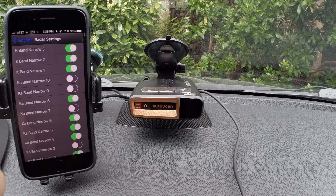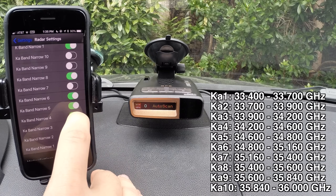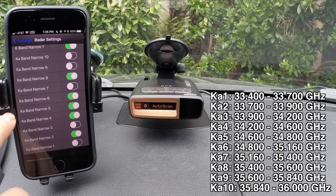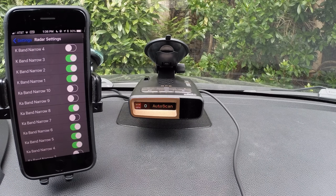The same applies to KA band. If you want to access KA band segmentation options, go up here and disable KA band — then you'll have all the segmentation options available. Here in the US, the main frequency ranges in use are segment two, segment five, and segment eight. Some people also scan segment four and segment six for out-of-tune guns transmitting around 34.7 GHz. Note that band segmentation adjusts only what frequencies the detector alerts to, not what it scans — it's always scanning the entirety of K or KA band. This is primarily for alerting and muting, not for performance.